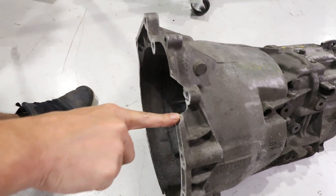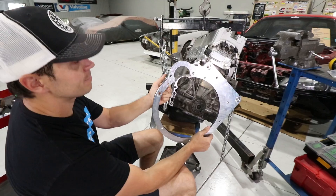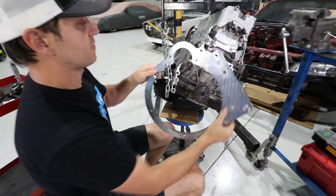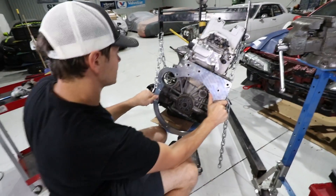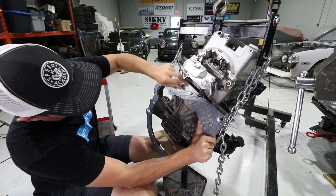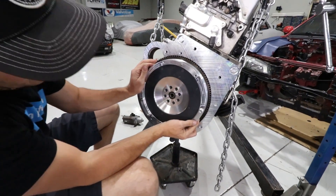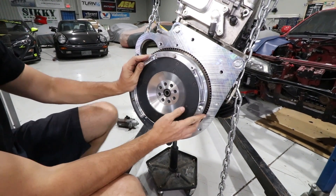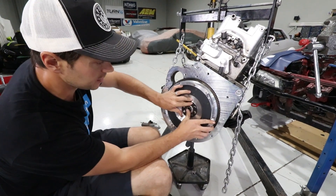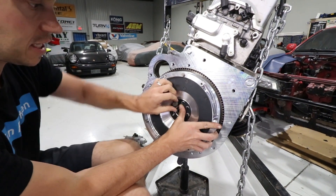Got the sweet notch job done - I think we are good to go. So it's finally time to bolt up our K-Miata adapter plate. They actually supply a small dowel pin - do not forget this before you put it on. As you can see, it fits up just so. Here is our K-Miata flywheel, and the beauty of this setup is it's going to allow us to run a standard BMW E46 or E36 clutch - no need for a custom clutch. You just bolt this up and pick whichever clutch you want for a standard BMW application.